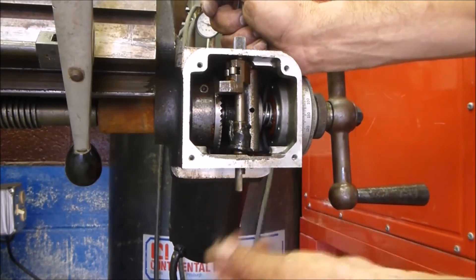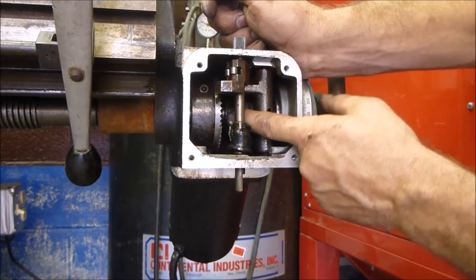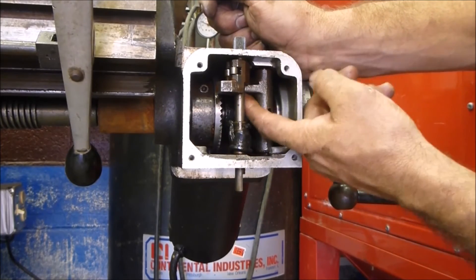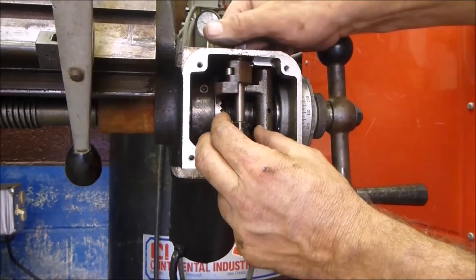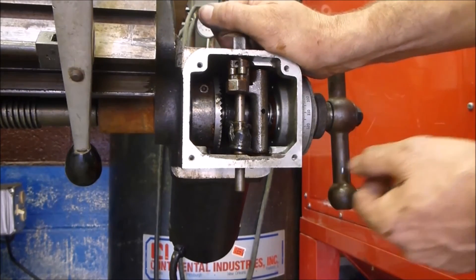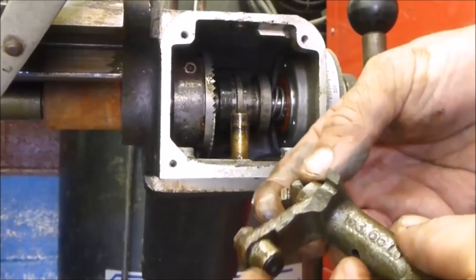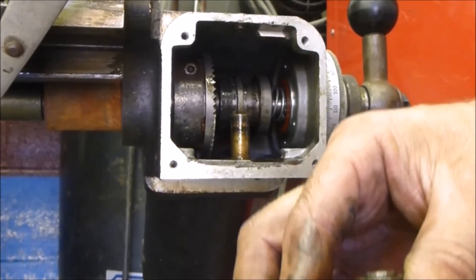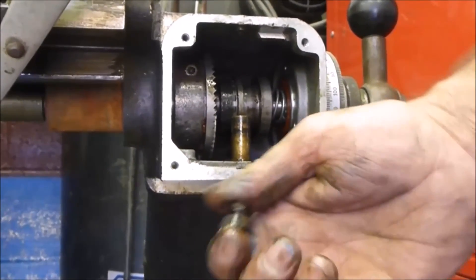As well as a hole in the bottom. What this arm does is it catches back here, and basically it looks like it's acting as a clutch, engaging and disengaging these gears. I can feel where it broke off back here. So I'm going to go ahead and tap this pin out, drop this down, see if I can remove this part of the shift rod, look at this piece and slide it out of the way, and see what I can do with it. You can see where this piece was supposed to be on here — it's a cast iron piece and it clearly broke.